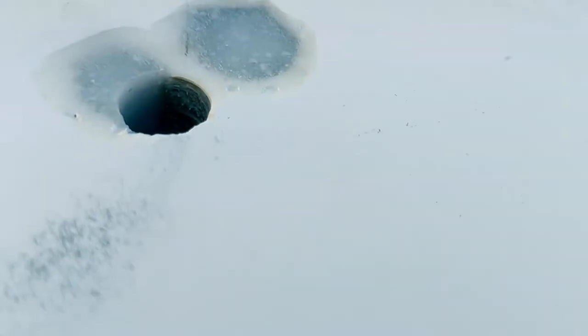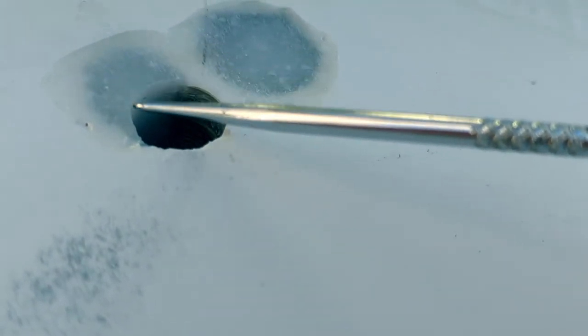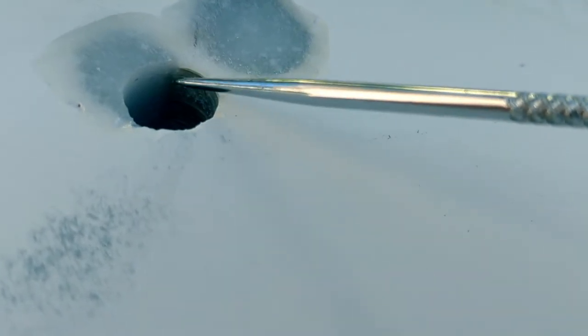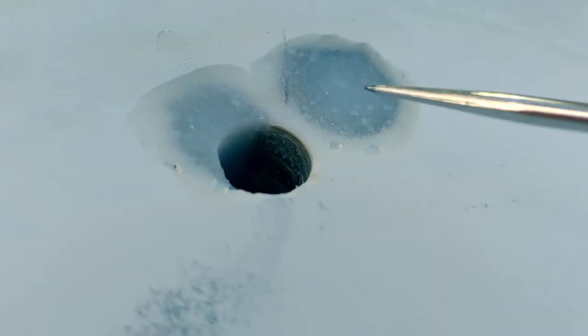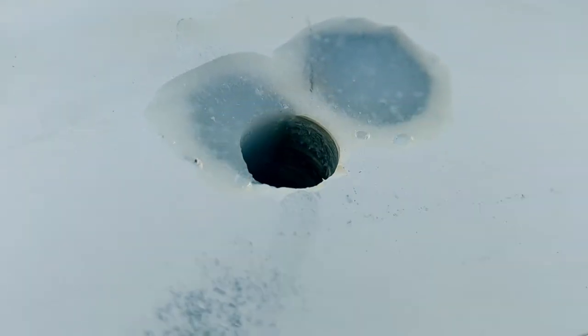All right, here's a great representation of the drill fill drill method. So if you notice, right here on this side, that's all epoxy. And then look at this side. That is all the balsa core material. And so the reason why we do the drill fill drill method is because once the fitting is in there, our screw, our bolt, here, let's get one out and I'll show you.